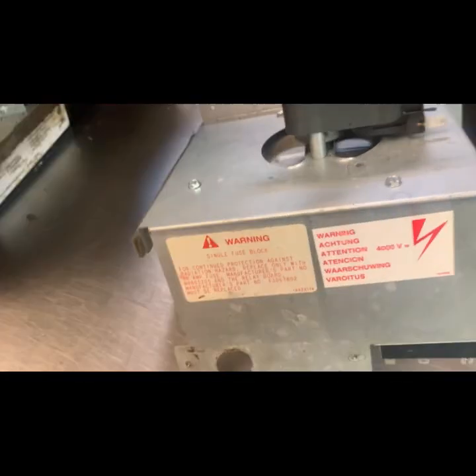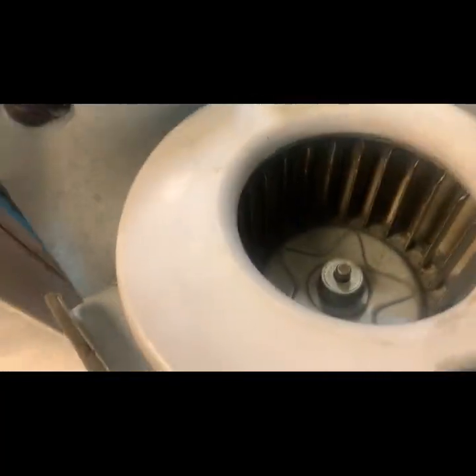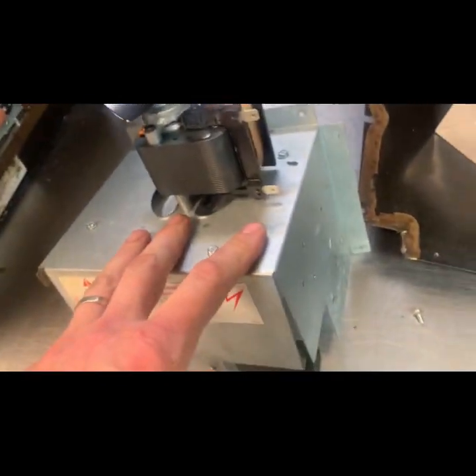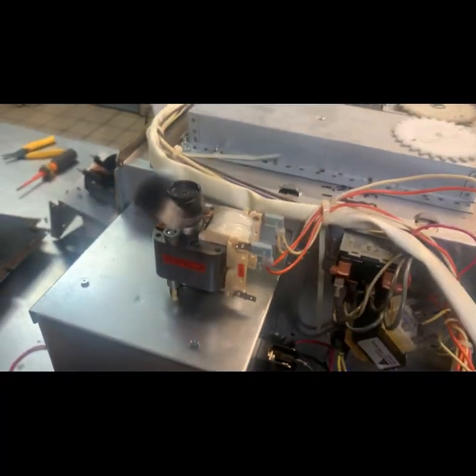I just got this on Amazon so you can get them from Parts Town — there's normally a number inside you can call or text to get the part number. The entire assembly means you don't have to fight with getting the blower off. They literally only wanted to sell it to me this way. Let's get it back together and let it run — make sure it doesn't show HOT anymore. But it won't — we saw it failed, now we see it alive. The end.